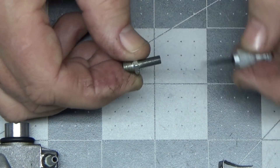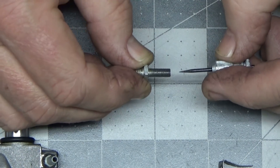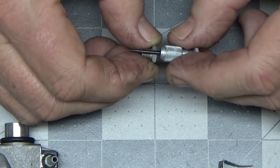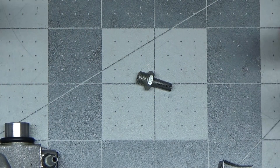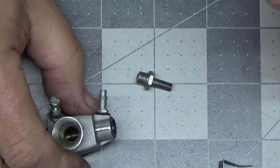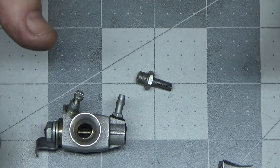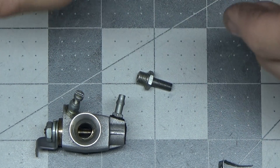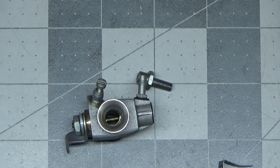What I'm probably going to end up doing is getting my Dremel out, fixturing this thing in the vise, and cutting off about three to four threads and seeing if that's enough. It really doesn't matter how much I trim — I have to be able to close off the flow of fuel completely, or in this case air completely, otherwise this engine is never going to run. This carb is never going to operate properly, because it has to be able to completely close off so you can lean it out adequately to get peak RPM. That's just the way a carb works.